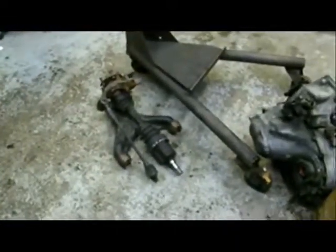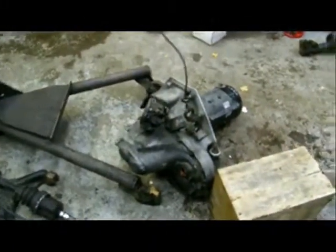Everything is pretty much in a mess here — motor off, A-frames and A-arms and whatnot. While I have the electric motor off, I might as well take it apart and check for wear on the flywheel and the coupler parts. Make sure it's all nice and tight because I don't really want to be doing this again for a while. I'll do the preventative maintenance and make sure everything is running well, because I have noticed a little grinding noise once in a while when I'm driving.